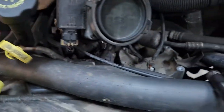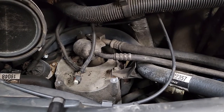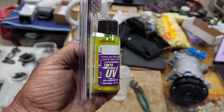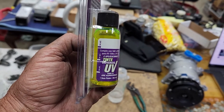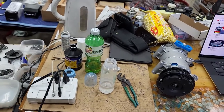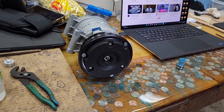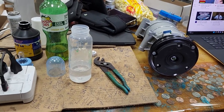Now we're going to install the compressor. What we're going to do next is put the oil and some dye in the compressor. The instructions say to add one-fourth of an ounce of dye to the oil. The system holds six ounces of oil. We have put three in this baby bottle - the compressor came pre-charged with three, so that'll be six ounces of oil total. A quarter ounce of dye so if we have any leaks, we should be able to find them.